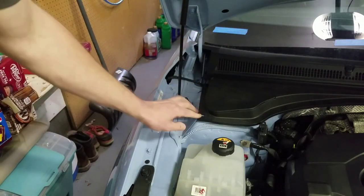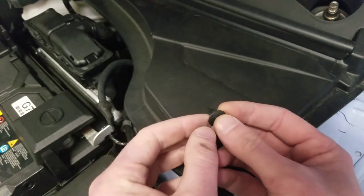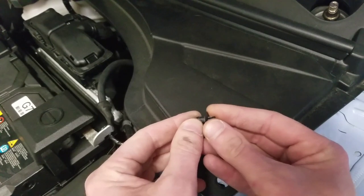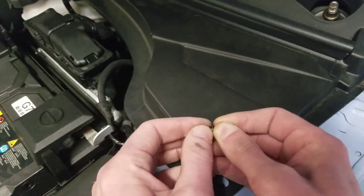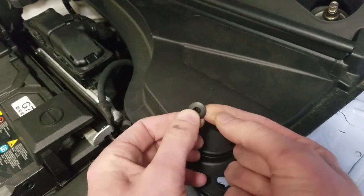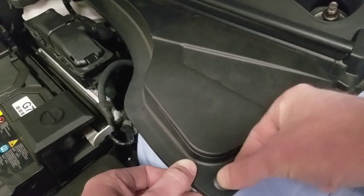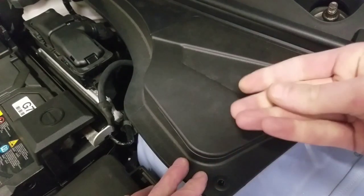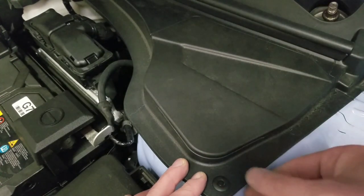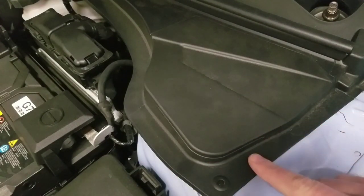Alright, now let's go ahead and put in our little clips. You push the center part in to disengage the locking mechanism - when you put these in it's a little different. Go ahead and disconnect it - just pull that center piece up and it will come out. You've got the base part and you've got the lock. Go ahead and align your hole and put the base in first. Then go ahead and take your center locking mechanism and put that in the center. Just push it down until you hear the click, then give it a little tug to see if it comes out. That is fully engaged - the plastic piece is secure.